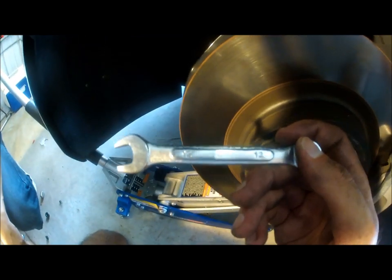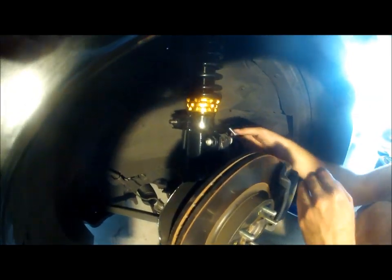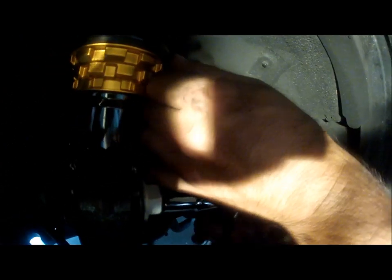The last thing left is attaching the brake line. What's provided is a nut and bolt. You're going to need a really small-headed 12mm ratchet. Put your nut in first, hold it with the wrench, then get the ratchet with the 12mm and tie it in place. Hold your brake bracket, and that's basically done. Then you're going to tighten the rest of your coilover bolts.